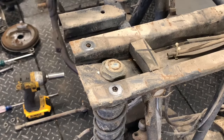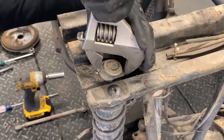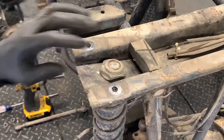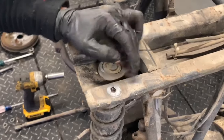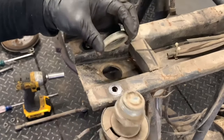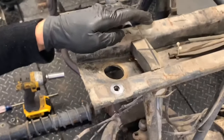I used a universal wrench for the top shock nut. It actually came off with very little pressure — it was quite loose, which tells me it probably doesn't need to be that tight. More than likely you'll be able to pull your nut off easily. I'll have the socket size listed below. Spin that off and there is your shock completely removed. We already removed the bottom earlier, and this frame will flip over if I let go, so I'll leave it here.